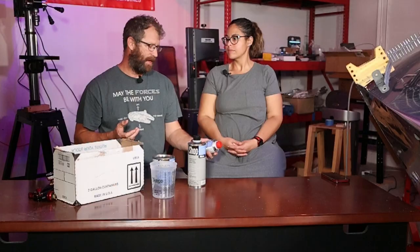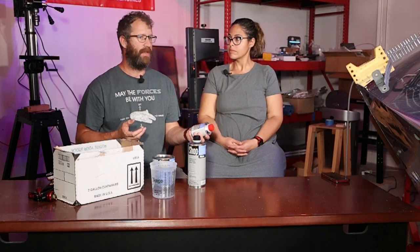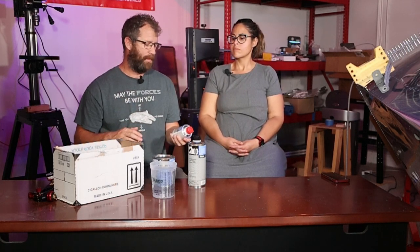Now, what I have learned, we have medium hardener, and he checked the forecast for temperature before selling us medium. You get slow, medium, or fast. If it's cold outside, you want fast. If it's medium, kind of like we're expecting in the low 80s, you want medium.